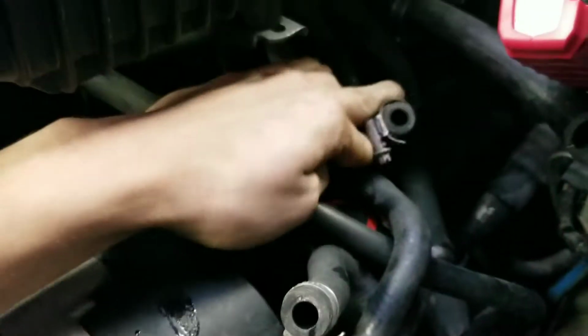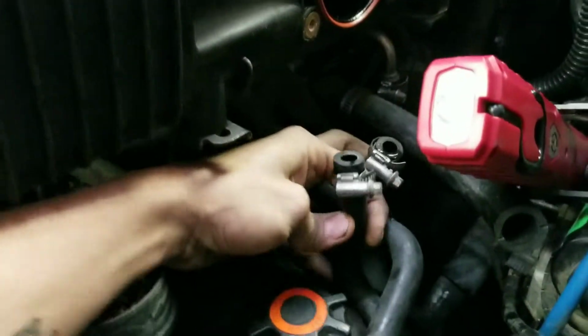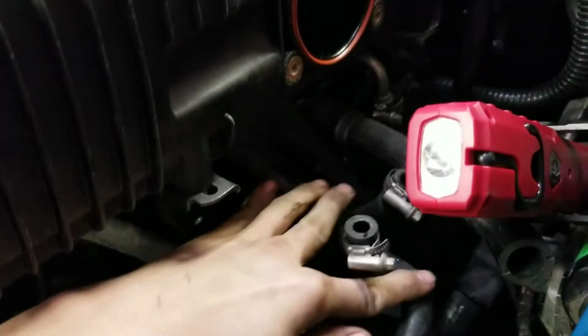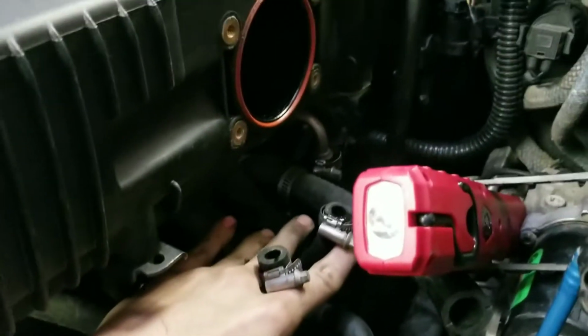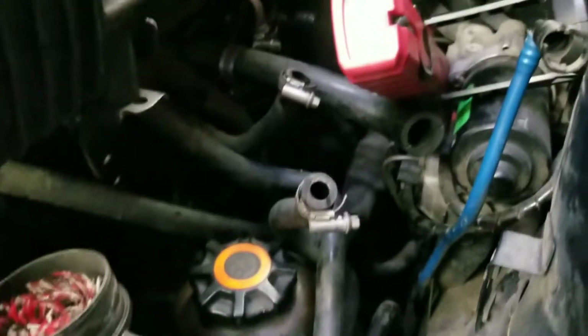However, there are two more coolant lines that run right here, and these both go into the bottom of the throttle body as well. That's what the other two bottom ports are for. Basically, it's just for cold weather starts and climates. It just heats up the throttle body so you get quicker, warmer ambient air temperature. I'm taking that out just because I don't want to keep it in there. It's just my summer car anyways.